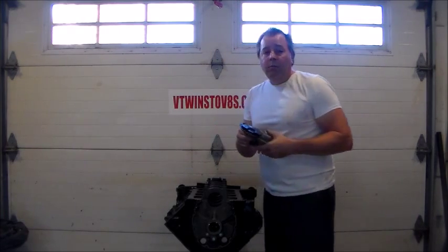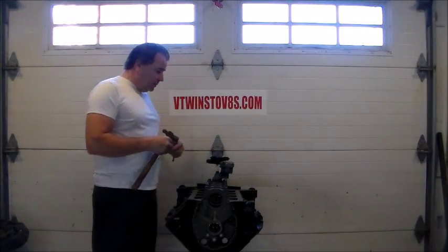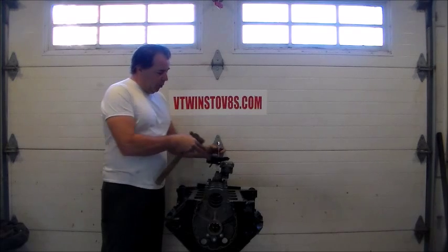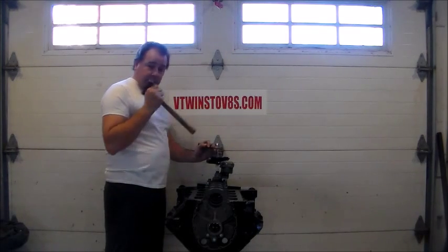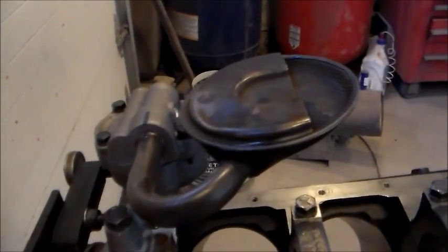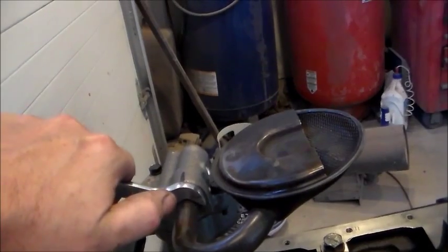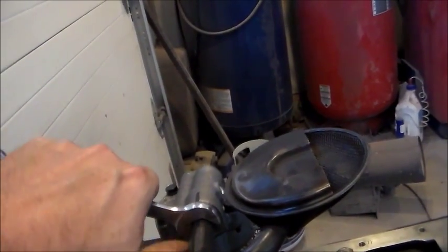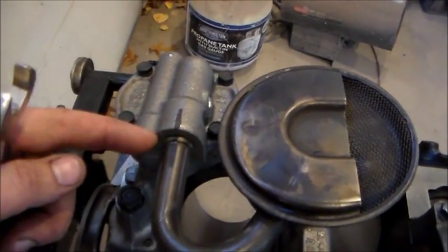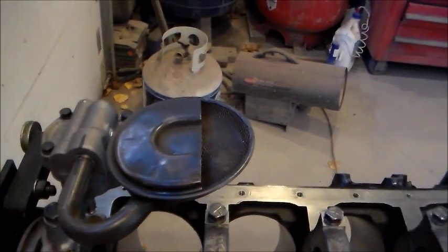I set this on my bench, took a wrench and slid it over the tube at the flange. I supported it and took a punch and a ball peen hammer and knocked it on. I tapped it on one side, then the other side, all the way around, walking it all the way in — you can see it's very deep and we're lined up with our mark. I slipped my oil pan on to make sure everything's all right — no obstructions and we're ready to go.